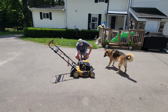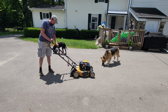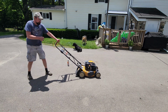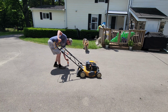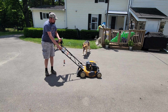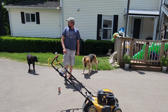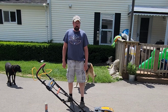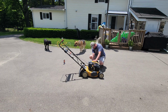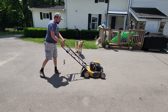What a beautiful day. There's 6 squishes. Oh, that smells like stale gas really bad. This does not turn the ignition off. Blade control. Alright, here we go. Here's some throat spray. Holy cow. Bees give me shivers. Okay, definitely fires up on starting fluid. I wonder if we just have a bunch of old fuel in the existing fuel line.